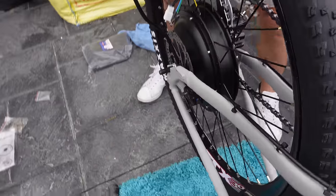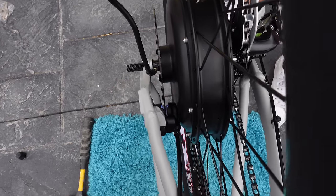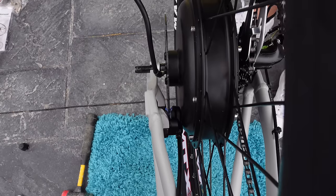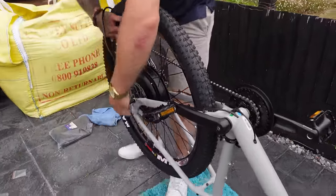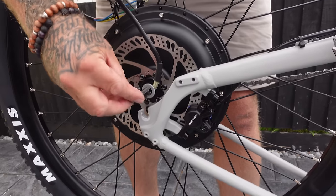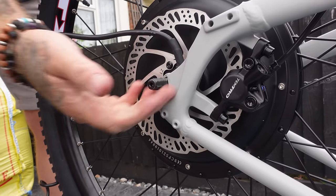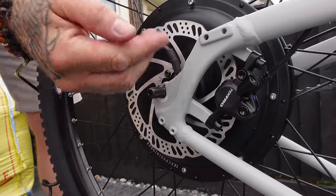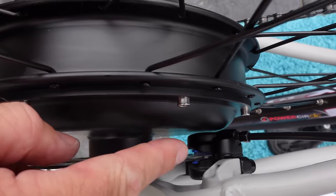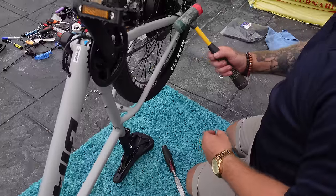Once it's getting into place, check both sides are seated. I can see that side is pretty much all the way down - that's how I want it. Looking from above at the caliper, I can see it's almost touching or is touching the caliper. So at this point I'm going to do what I said before and put an extra additional washer in, then reinstall it. Now if you look at the gap, you will see there is an actual gap between the electric hub wheel and the caliper - as long as you've got that gap, that side is perfect.